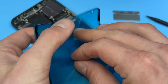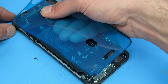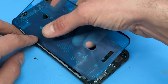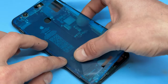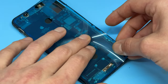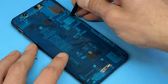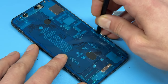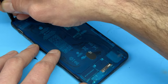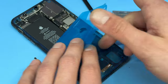With the chassis cleaned, get the new dust and moisture resistant seal. Always place it in the top left corner first, secure it along the left-hand edge, and the rest will follow as long as that first edge lines up nicely. If it's not sitting completely flat, use the back edge of the spudger to push it down, then peel back the top layer of the film.